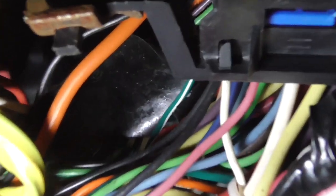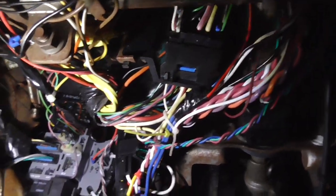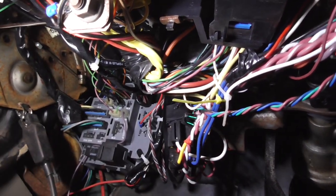The brake wire, at least for 95-ish and up, is right there on the bottom on the left side - there's a white wire, and above it is a pink wire. That white wire is your brake feed. I have my alarm wiring connected up at the top, going all the way up to the controller itself, which is a pain. I'd rather just tap off this wire right here and use that for the brake controller.